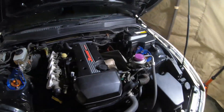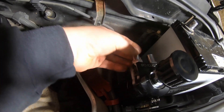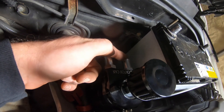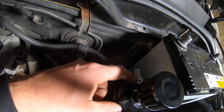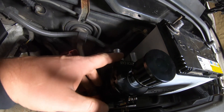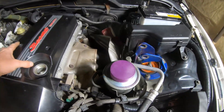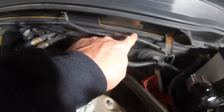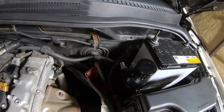See that? Now this one is an outlet which I won't be using, so I need to find the correct thread and I'll just put a bolt in there to block that off. This needs to go to the blow-by, which normally vents to atmosphere - it goes in behind the air filter. So it's going to be running basically stock, which'll be fine. This one will swoop around next to that, over here, behind, and then plug into that there. And then we've got a filter breathing to atmosphere, as it would be OEM style.